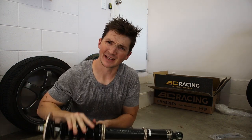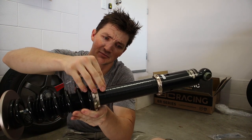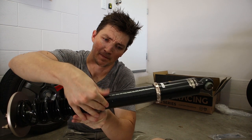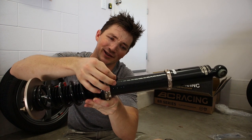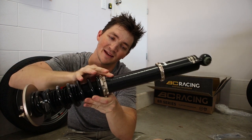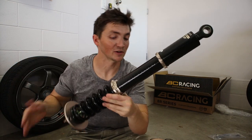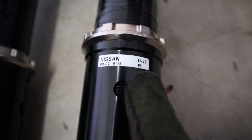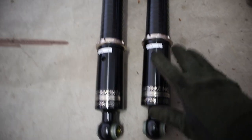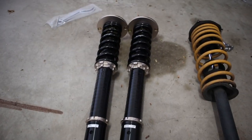Just to make the end of the tape a bit more obvious, I'm just going to fold this section so that it protrudes, sort of like that. So hopefully when I come to adjust them in the future, I'll be able to find this little tab and remove it without having to cut all the rest of it off. I was just looking to see which side is which — it's just got R there for rear. I believe these are universal; they can go on either side, it's just a reverse procedure. You've got the two bolts at the top, the one at the bottom, and we should be done. Should be pretty easy.